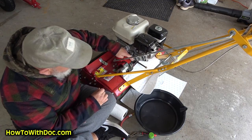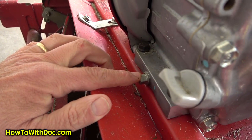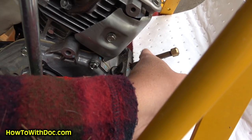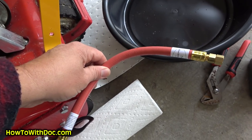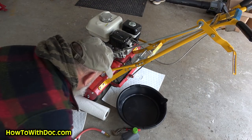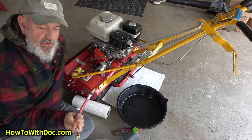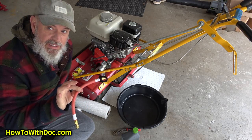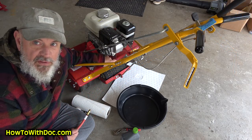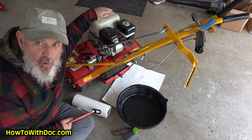We are going to put on — let me grab the camera and show you. On these engines you're going to have a fill cap here and a fill cap on the back. One is black, one is gray. Then you're going to have these bolts — that's your oil drain, there's one here and one on the back. Now I installed a tube on here last year, but the problem is that tube drains right onto the tire. So I'm going to replace them all with these quick-change tubes — I'll link to these — and then that'll drain into the pan. Be aware of the size of this bolt: I believe they're 10 millimeters. These GX series, most of them will have a 10 millimeter. You'll need to pull out your owner's manual to see what thread that is. We're going to pull this off and screw this thing on — it'll get a little bit of spillage, not much. Then we'll start this engine, warm it up, and drain the oil.